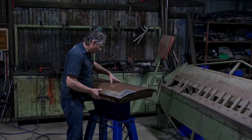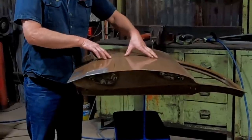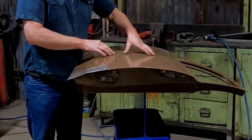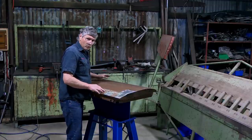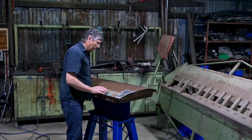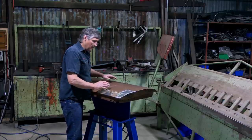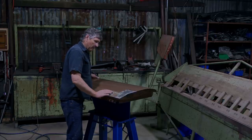With this panel cut like this it's going to be very easy to bend it. We've lost the strength in the panel now because these two pieces of metal will move quite happily against each other. When you're working at things like that it's best to have it well supported. For now I'm just going to sit it on my little bench, but a trestle might actually be better than the steel bench so that we don't cause any damage to the piece of door that we want to save.